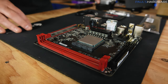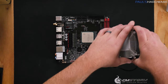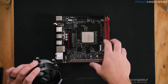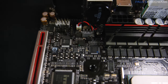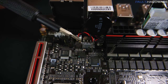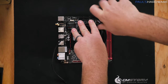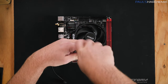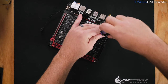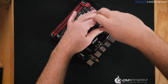To mount the heatsink fan, line up the screws with where they go, and bear in mind you've got a little cable coming off the side to plug in the fan. Reality check and make sure you know where to plug it in — it should be labeled as the CPU fan header. On this particular motherboard it's located right over here as a little gray plug. Make sure you have enough cable length to route over to it. Start by just giving a couple turns to each screw to get it threaded onto the back plate — you don't want to tighten one corner down before starting the other screws, as that puts disproportionate force on one corner of the CPU.